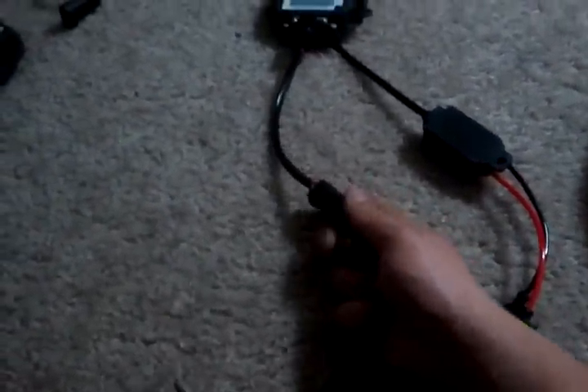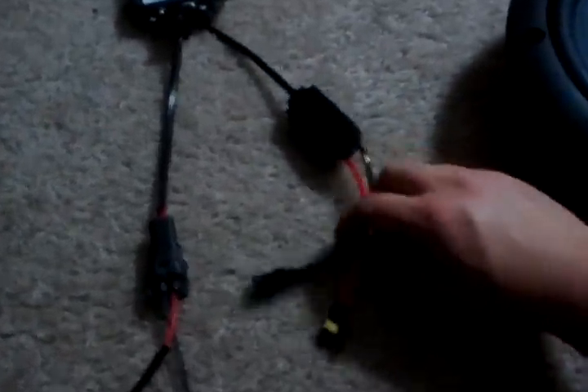Here is a fuse, and there's the power wire you'd want to connect to your battery. So you take this clip and plug it into your ballast — there's only one spot in this kit where you do that, it's just a simple one-way clip pin. You'll hear it click. Then you'll have these two other wires from the ballast, and these plug directly into your bulb.